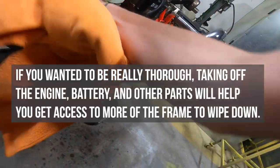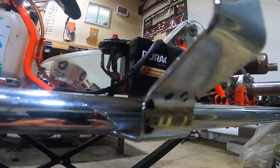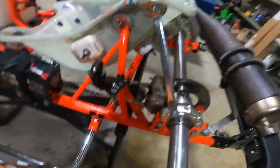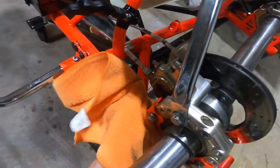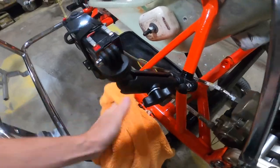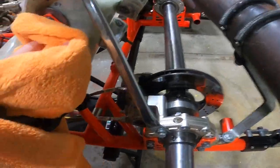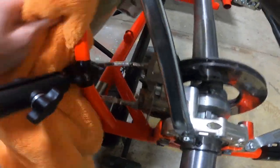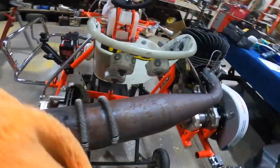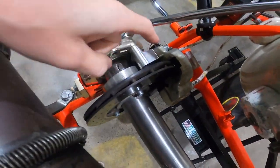You can see it's making it nice and shiny — everyone loves shiny go-karts. On these side pod bars you get a lot of rubber buildup, and WD-40 does a pretty good job of getting rid of that rubber too. I'm using WD-40 on most of the frame because I don't want to use brake cleaner if I can avoid it. One thing to be careful of is not getting WD-40 on your actual brakes — you don't want lubricated brake rotors or pads. A good strategy is to spray those out with brake cleaner at the end so it removes any WD-40 that got on there.